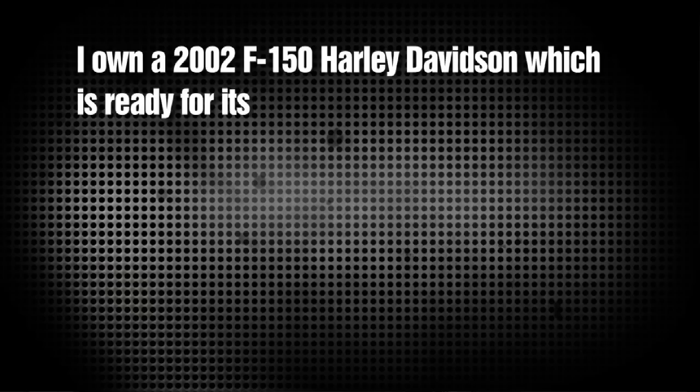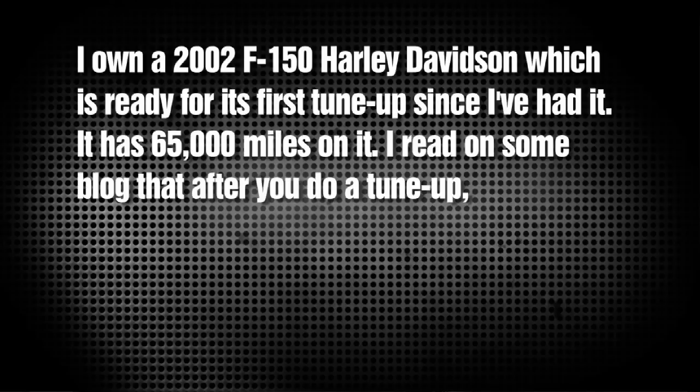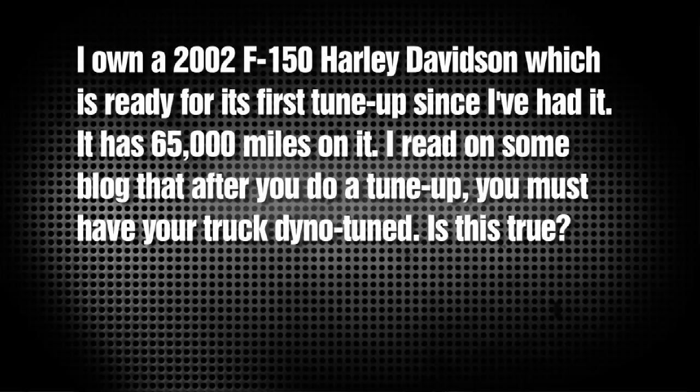Now, Marvin Johnson writes and says, "Hey, Chris, great show. I own a 2002 F-150 Harley Davidson, which is ready for its first tune-up since I've had it. It has 65,000 miles on it. I read on some blog that after you do a tune-up, you must have your truck dyno-tuned. Is this true?" Well, Marvin, unless you've changed something major inside your engine or to the computer itself, you don't have to do a dyno.